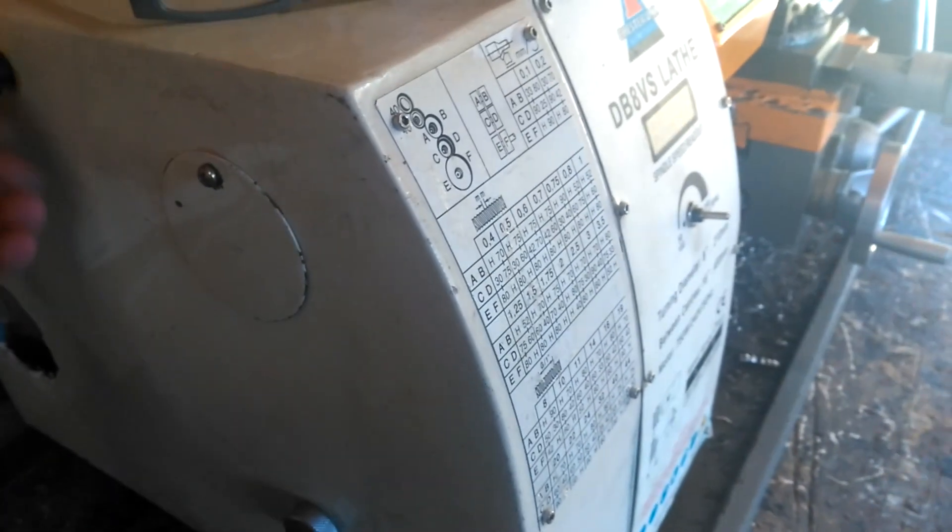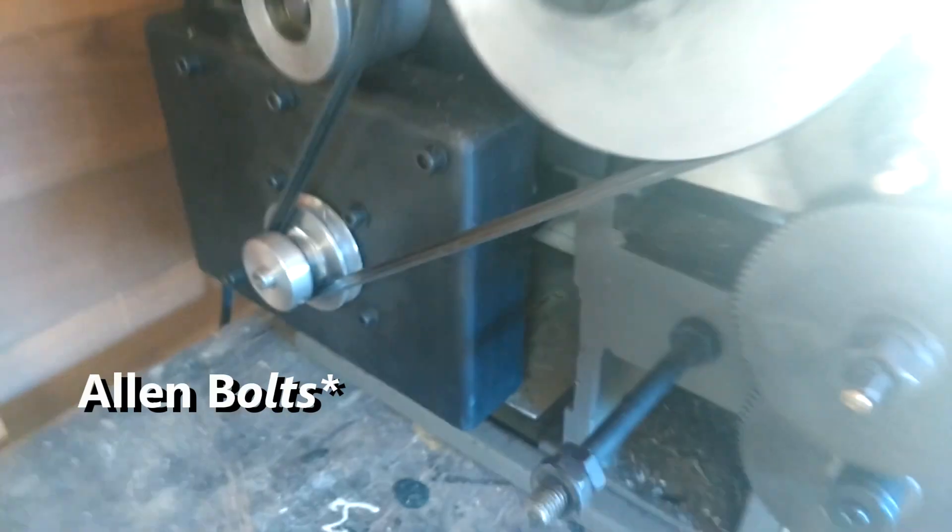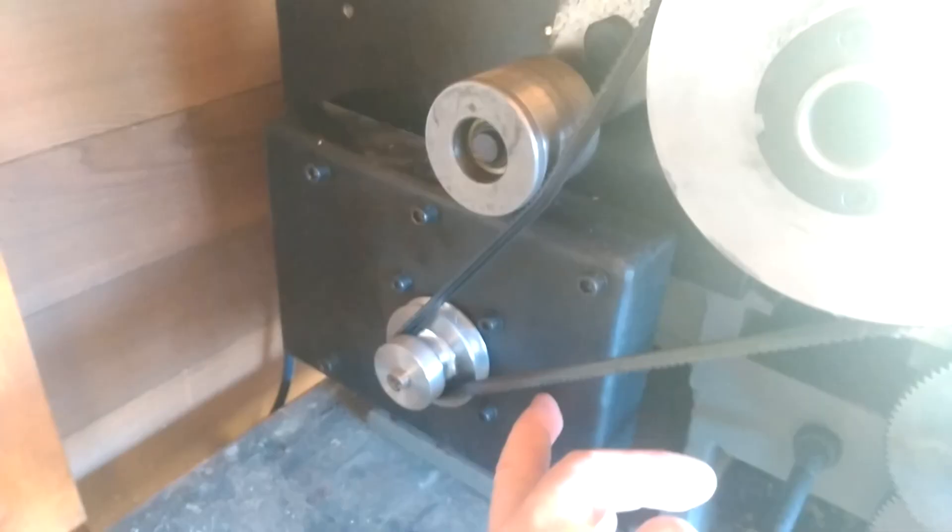If we look inside the housing here, which is where the gearbox is and some other bits and pieces, we can see that the motor is mounted in there, just tapping its body with this drill. And there is no cooling. The motor is behind this plate here, bolted to this plate with these four allen keys. Even this plate here gets too hot to touch. The motor itself is enclosed in this box, and there's no venting in this box either. All in all, it's a recipe for the motor to get very hot.